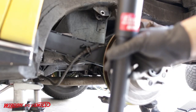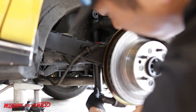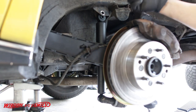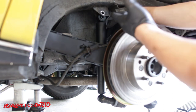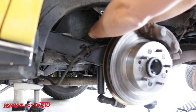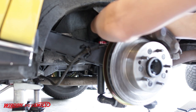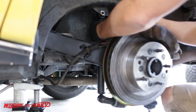What I like to do is put in the bottom shock bolt first — feed it through and get the bottom one in. Then to get the top one in, just press down a little bit. You can see it's not going straight up because there's a bit of a kink since everything is jacked up. Just take your hand and force it up there ever so gently, twist it back and forth, and let the shock expand on its own.